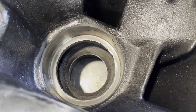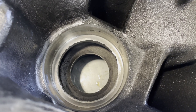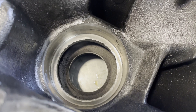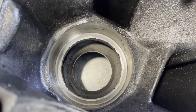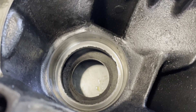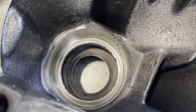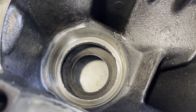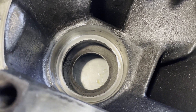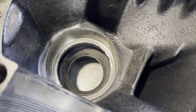We have the high spots ground down. Basically, what I did was: any spot that caught my fingernail, I just ground it flat. Nothing catches my fingernail now, and I'm confident that the race will fully seat. Try not to make this mistake when you do yours, but if you do, this is how I fixed mine. There's plenty of area there for the race to seat, and nothing is going to push it one direction or another. Thanks for watching, and we'll see you on the next one.